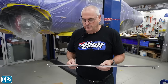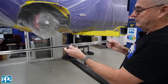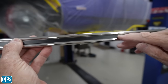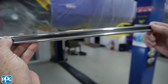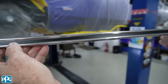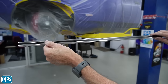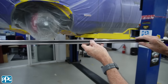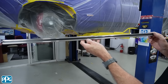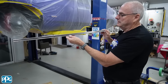This is one of those little things you did and sort of went 'I probably should have changed that.' This piece goes on the boot lid and when the boot's open at the show, I've painted the black and you can see these little bits and pieces where I've taken the fine line tape off - I've either left it not long enough, because with fine line you've got to pull it off when it's wet or wait until it's totally dry. It's taken a few little bits out and the problem is black against the stainless - my eye gets drawn to those sorts of things. At this level of car at something like Motorex and Superstars it's really not good enough, so I'm going to paint-strip that off, re-mask it and paint it again.